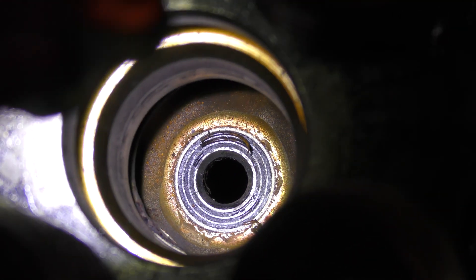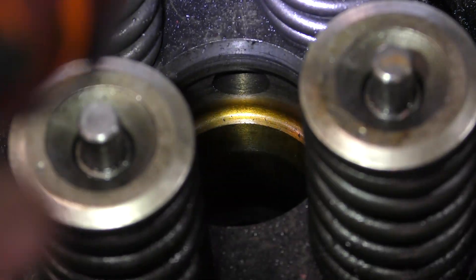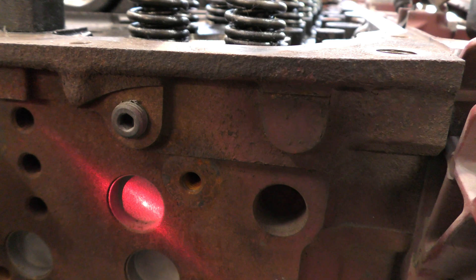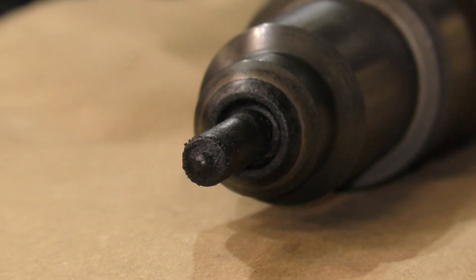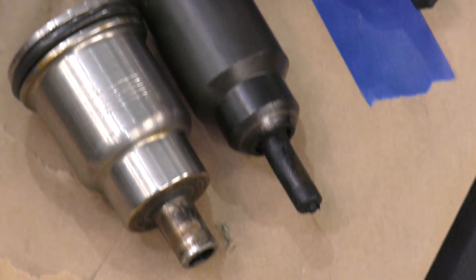If you look down the injector bore, you can see the cup seat with a clear view. You can also see the water jackets surrounding it. Towards the top of the bore, you can see a thin channel that runs parallel with the valve train. This is the internal fuel rail that provides the injector with fuel during the filling phase. The upper plug is meant to provide access should you want to test the mechanical pressure of the internal fuel rail. The lower port is the core plug for the cooling jackets. The injector will quite literally stay suspended in that jacket, held in place inside of the injector sleeve, and that's what allows the injector to cool while it's operating. From the upper O-ring to the lower cup seal, the entire cup is surrounded by water during engine operation.